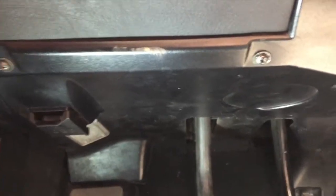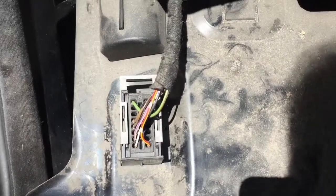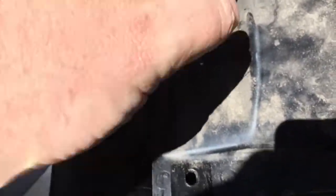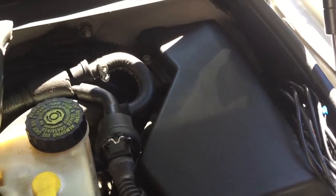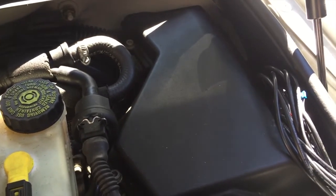Next I'm going to remove this upper panel here. I'm going to try to see if I can find a way through the firewall. So there was a little knob — I'll show you a picture. I turn that, now this comes down and you can see the OBD port here. That looks like it slides up to release this clip, and there's a little light connector here as well. So next I'm going to take this cover off and take a peek in there so I can see where that cable bundle goes through the firewall above the dead pedal.